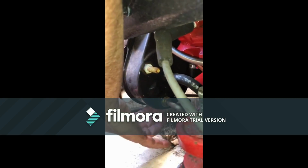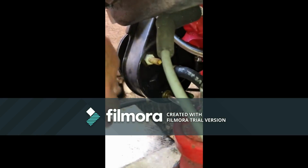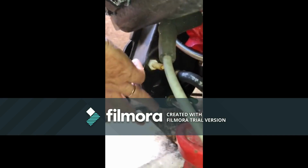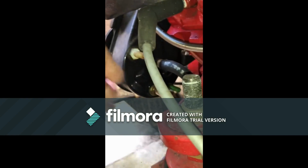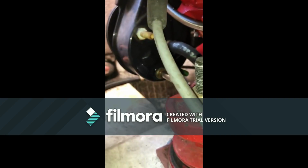If I come around here to my left, I can see the back of the power steering pump. And I don't see any leaks on the fiberglass underneath here. This hose is dry. I spilled a little bit of oil putting oil in it yesterday, so there's a tiny bit on here, but I just don't see any leaks under here yet. I'm not seeing any leaks along the length of the hoses down there. Kind of hard to see, but they're going back to the actuator.